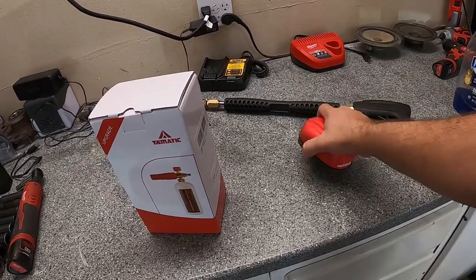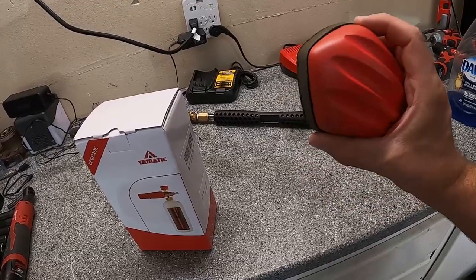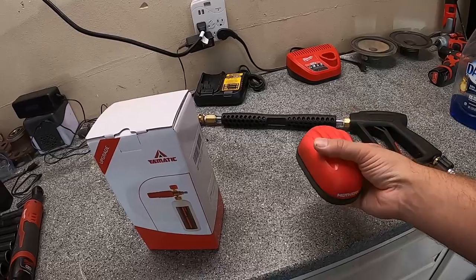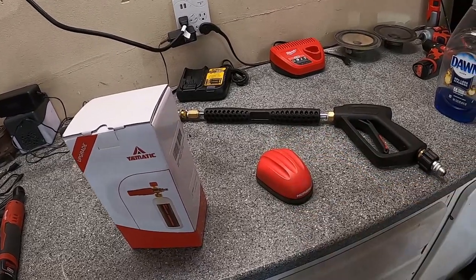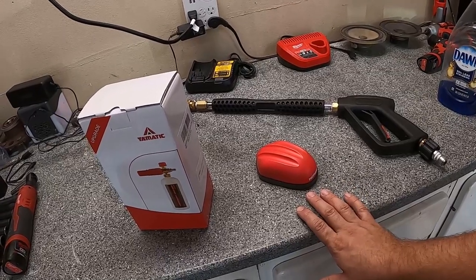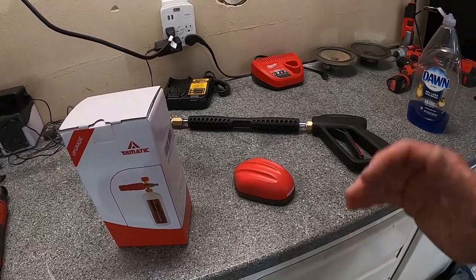Once that's completed, we'll go through, take our clay bar here, which is actually a speed clay bar. So these are super nice, way better than using the actual clay, and should be a lot quicker than using clay. So we'll go ahead and get the exterior of that all cleaned up to remove any kind of rail dust or any kind of other contaminants on the surface. And then we'll give it one final wash again with the pressure washer and Dawn dish soap. Once that's completed, we'll move it over into the canopy, get it taped up as far as like moldings and trim go, and we'll start with our buffing and polishing process.